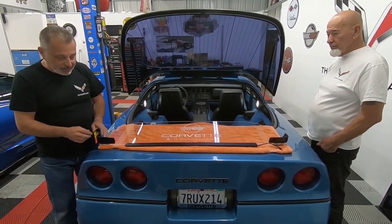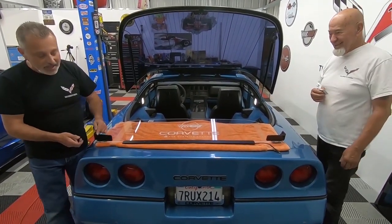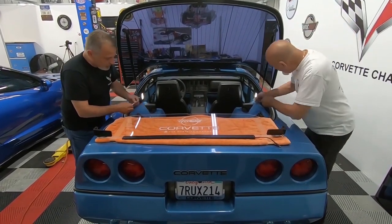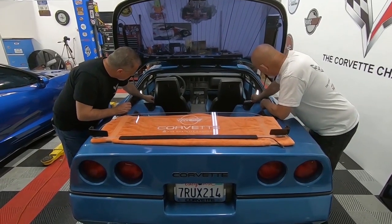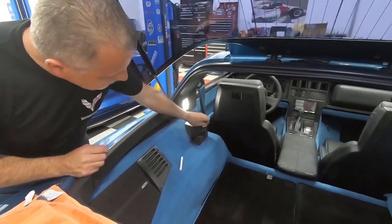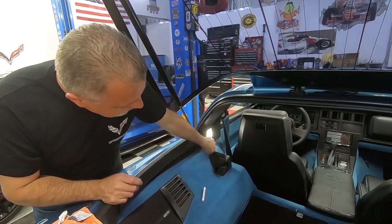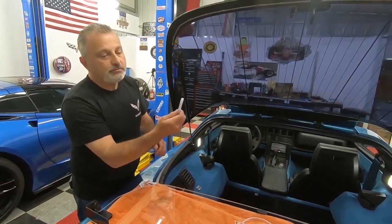So Terry and I already cheated a little — we always have problems getting the tape off, but there's sticky tape right here at the bottom. The first thing we need to do is use the included alcohol swabs to wipe down the top of this area here, getting any oils off of it. C4s have been around a long time so they've probably got Armor All on them. You can see there's a lot of stuff on that surface. Then just let that dry for a second, and then it comes with an adhesion promoter — just squeeze it right there in the middle and you'll hear it crack.